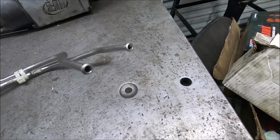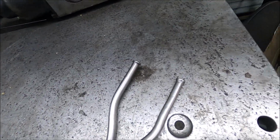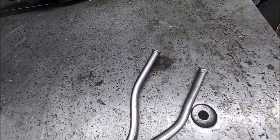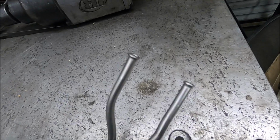And if you don't do this to it, over the years I've seen many cars where people put an aftermarket transmission cooler and they just cut the lines off. What happens is it blows the hoses off, and you see them with a whole bunch of hose clamps on each hose. So this works perfect when you do this, and it can't do that.